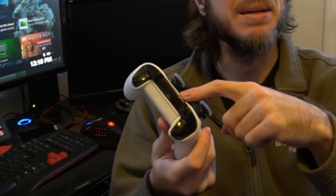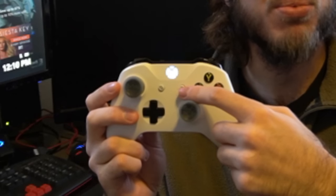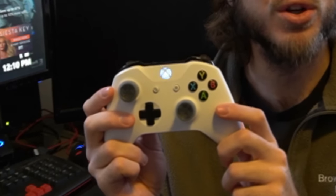The first way I'm going to show you is very easy — it involves pressing the sync button on your controller and the Xbox One at the same time. However, did you know that your controller may not be in sync mode even though your light is blinking? There are two different speeds to the light blinking: one is a slower blink, and the other is a faster blink. This faster blink means your controller is in bind mode. When you press the sync button, also called the bind button, on the controller, it will blink fast, meaning your Xbox One controller is searching for available consoles to connect to.